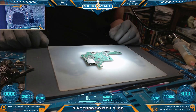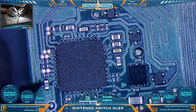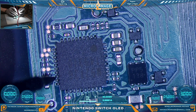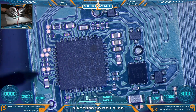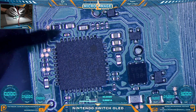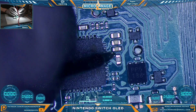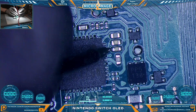We have our board out of the housing. We'll begin our testing on the M92T36, which is located here on the board for your orientation purposes. We're going to be checking all the capacitors around this chip and following these little traces that go from the capacitors to the chip. That's generally the side we do not want shorted to ground. Let's test. We definitely have a short right here, which is indicating that our M92T36 is bad.